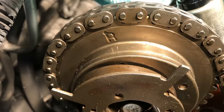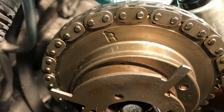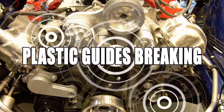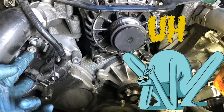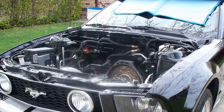Also in the V6s, they have timing chains both in the front and the back of the engine. By about 150,000 miles, they may develop noise from the tensioners going out and the plastic guides breaking. This can cause the engine to jump its timing sequence and run rough or simply not turn over. You will need to remove the engine to fix those issues, and that alone is a huge deal breaker.